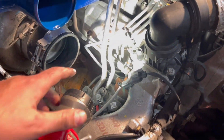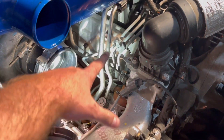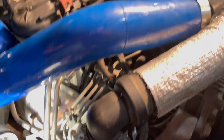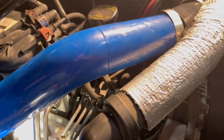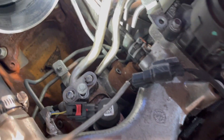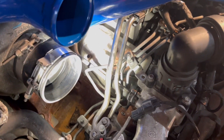Now we're getting all these fuel lines loosened up. These feed lines feed two injectors. I still can't get this boost tube out because right down there there's a hold for all of those lines and I can't get to it because that tube's in the way — but it's seized on. So I got to get those and try to get this thing freed up and then wedge it out of there.